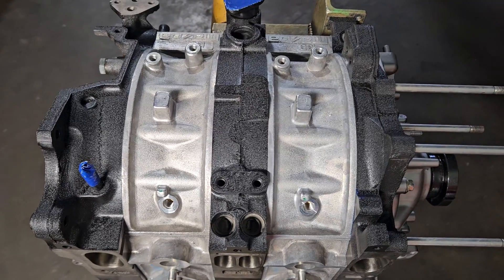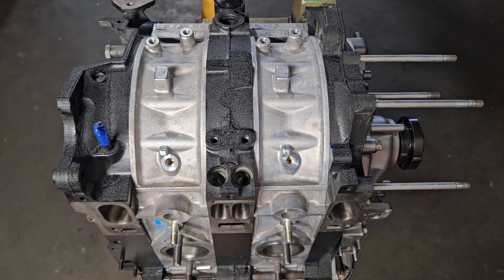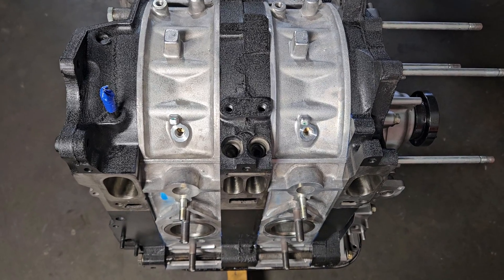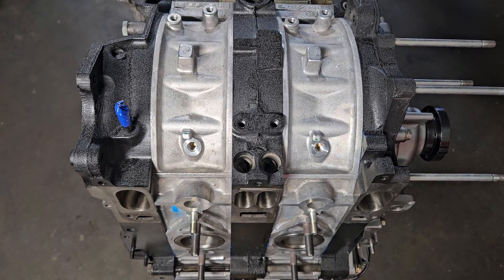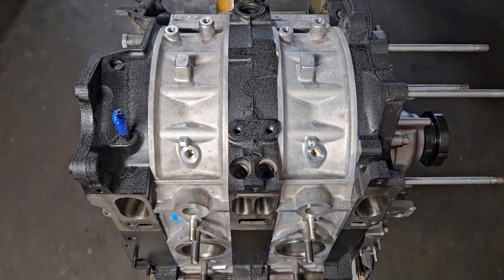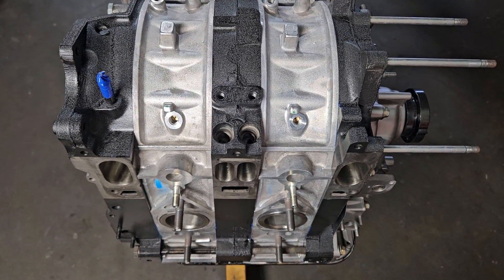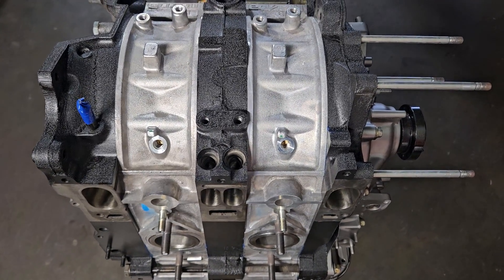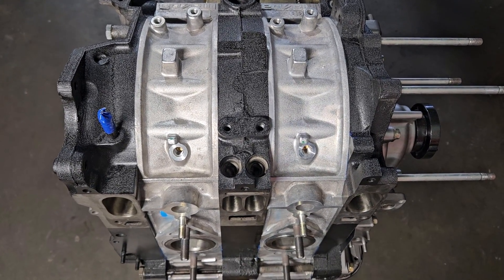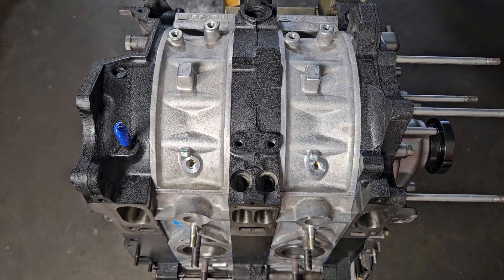In this case we were able to reuse the customer's rotating assembly and stationary gears, with new bearings throughout — new rotor bearings, new main bearings — and bumped up the oil pressure via a race regulator. Since it is a half bridge going single turbo, this is more of a performance build going from a mild street port to a more aggressive half bridge single-turbo setup. We went with all new OEM bearings and all new OEM seals — side seals, springs, and corner seals.